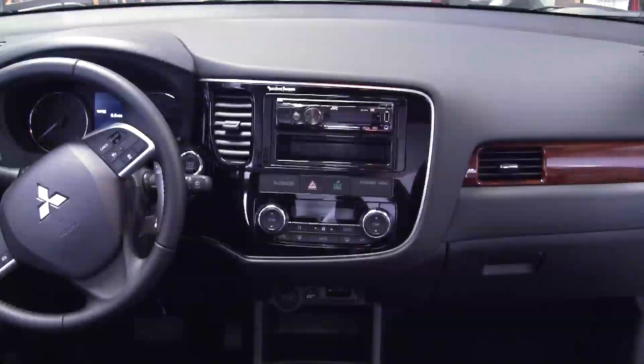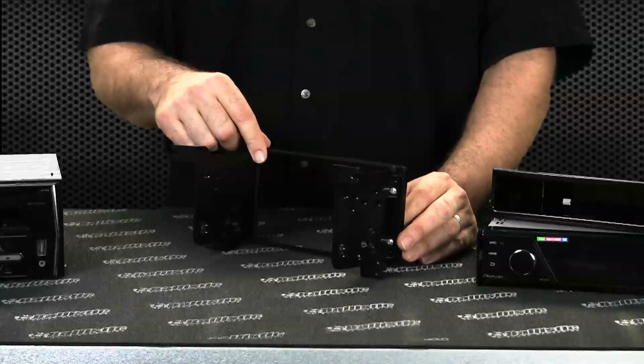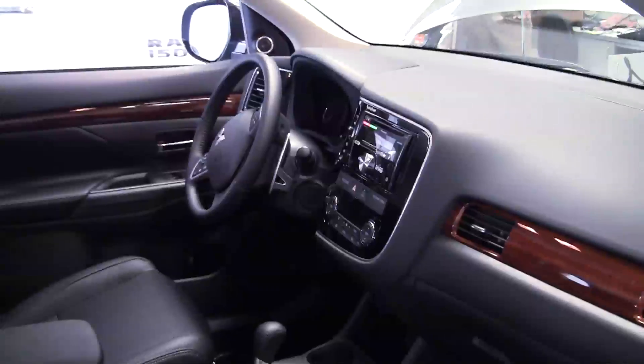I know it's a small piece of plastic, but it looks nice when it's in the car. So again, double din and single din specific. It's a real simple kit assembly — the brackets just screw to the back of the trim plate, radio slides into the kit, kit bolts into the dash, and all this is explained in Metro's instruction manuals.